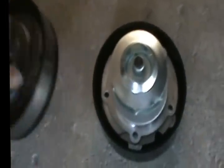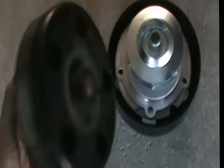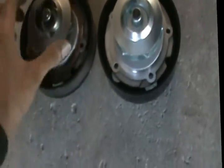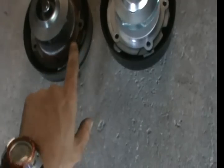Here's the pump — that's the old one we just took out. The old one looks okay, but when it spins it squeals, and we found the seal was broken in one area so it was leaking. That's the new one, and that's the new seal you have to put in. Before you put the new one with the new seal, let me show you where I took it from and how I did it.